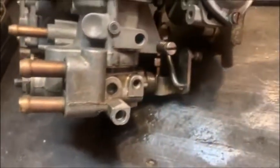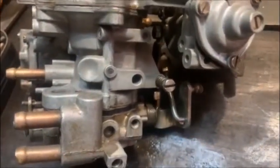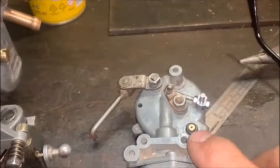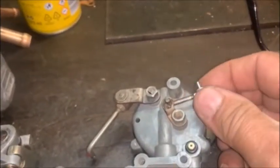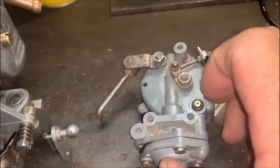The last thing I'm going to do here is put a new O-ring on the idle mixture screw and put it in place. When you put your choke back, remember to put that little O-ring in. I've also made a little fitting for that connection - it's now adjustable - so I'll put all of that on and see how it works.